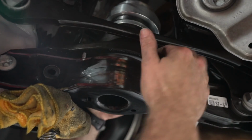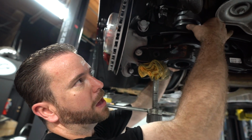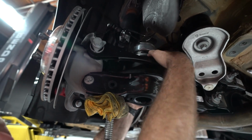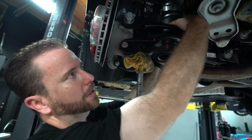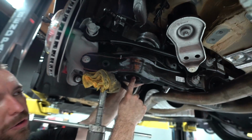Well, everything's really possible, it's just a matter of what our approach is going to have to be to get it in there. For me, I remove the spring, throw this bag in place of it just to see where we're at, and compress it up. From there, I'll adjust it in and out, depending on what we need for clearance, left and right between this front axle and this back toe arm. Then we also have the shock absorber on the outside that we need to keep it away from. So from there, it's a matter of connecting dots from the bag to the body to keep everything accurately located. We're going to build something to go up inside this upper nipple section, and then we'll build one to go down inside this lower control arm section as well.